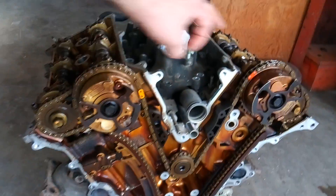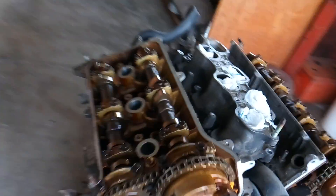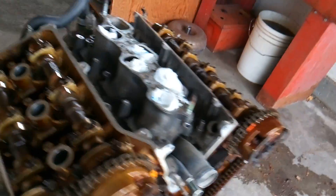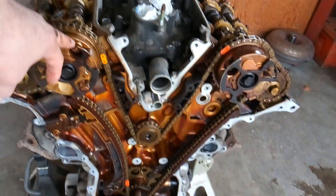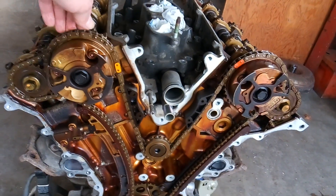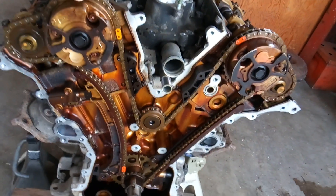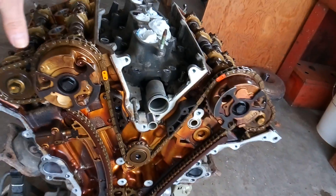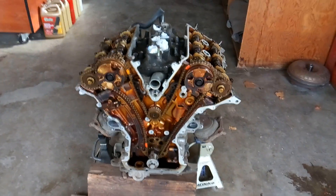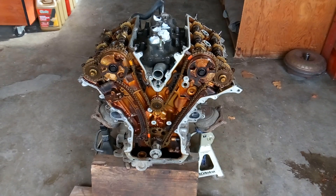You'll have different marks to line up with your engine so you know you're set at TDC. If you attempt to replace a timing chain or timing belt without setting your engine at TDC, you risk causing valve damage, piston damage — in other words, thousands of dollars worth of damage. So I'm going to pause and show you my method for setting TDC.